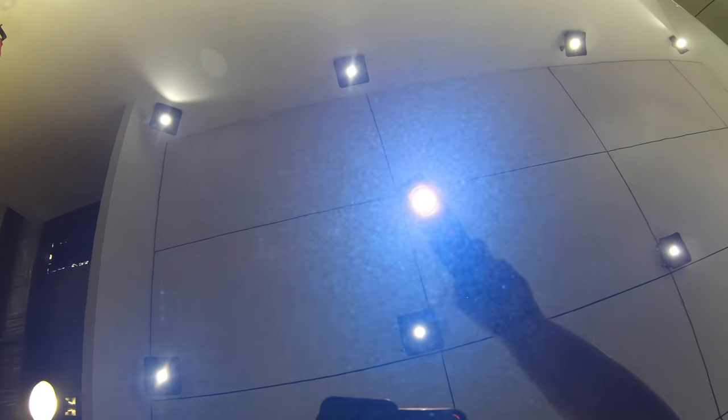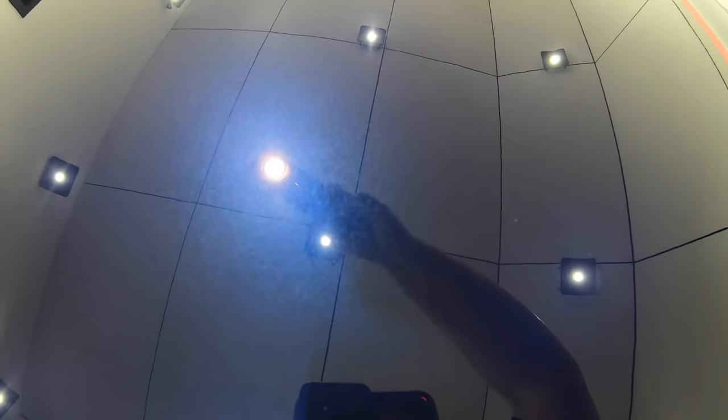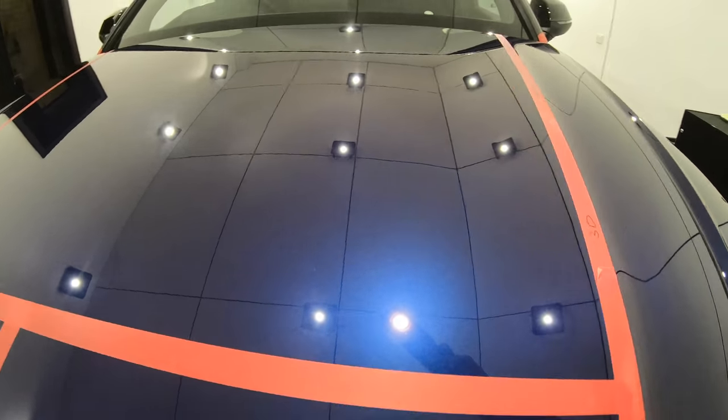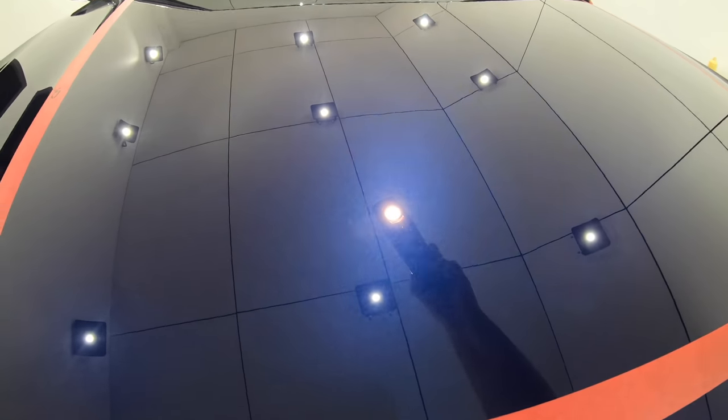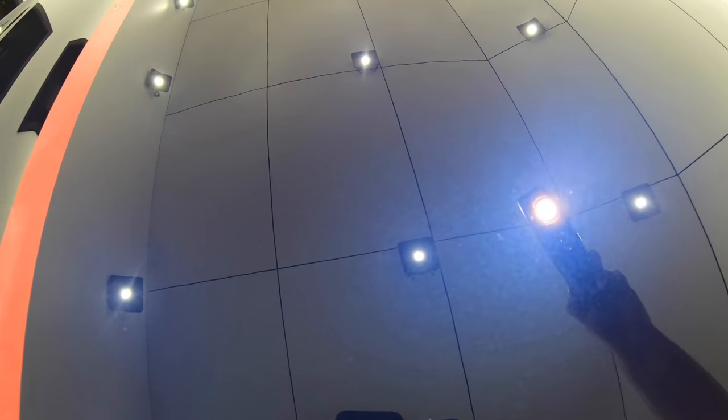It was just harder to blow out the residue with all three compounds, and also harder to wipe off the compound from the paint with increased heat when used on microfiber. And although the cut was still quite good across the board, the finish was definitely a step down compared to the last section. But this could also be due to the larger polishing pads and the larger orbital throw of the machine.